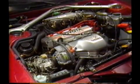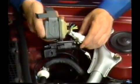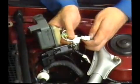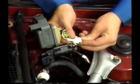This is done by 1. Stopping the vehicle, 2. Disconnecting the check connector, and 3. Depressing the brake pedal 8 times or more in 3 seconds. This will eliminate the code numbers from the memory. Then, 4. Check that the warning light shows the normal code. And 5. Connect the check connector.